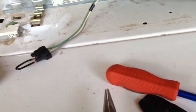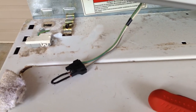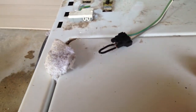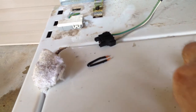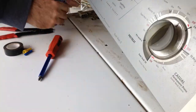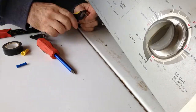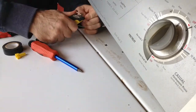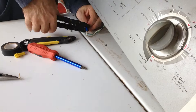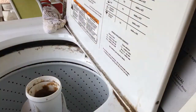When I did that, it had power and it started to spin. So that has to be my problem. So what I'm going to do now is I'm going to cut these and put them together. I don't have a new switch and my plug is kind of messed up, so I would need a new plug too. You can see it's been getting hot there — right there, see it's been getting hot. So this is definitely most likely the problem. All I'm going to do is cut those wires and put those together and we'll see if it works.